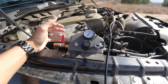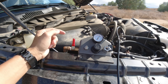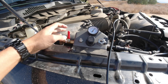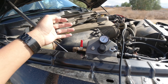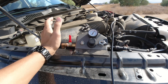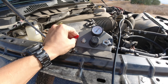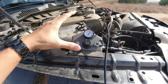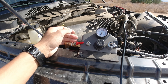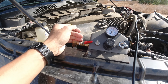My system is installed a little bit differently because I have an extra air tank — it's a two or two-and-a-half gallon tank. I did put a little valve on here so I can open and close it. When I close it, it prevents air going from the tires into the tank and vice versa, so I can still have a full tank and control my tire pressure without messing with the air in the tank. What I like about having this setup is if I am airing down, I'll flip this little valve so air from the tires will go and fill up the air tank partially. It's not super fast, but it does save a little bit of wear and tear on your compressor and can get it up to 15, 20, or 30 PSI — whatever you might have your tires at.